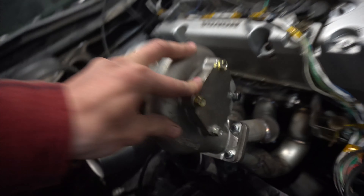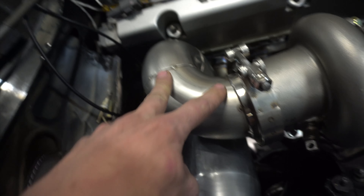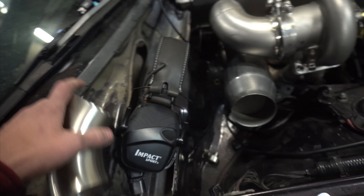Started working on the exhaust — got the EFR turbine housing, and this is just a stainless plate I cut out to seal the front until I can afford the rest of an expensive turbo. The exhaust is a three-inch tube with a one-radius (1R) — three-inch centerline radius — so it's very tight. Goes from the manifold to a catalytic converter, which tends to quiet things better than a muffler, then a Super Trap muffler on top if needed.